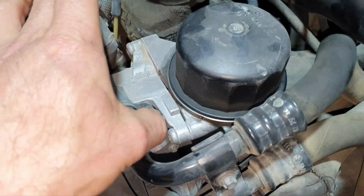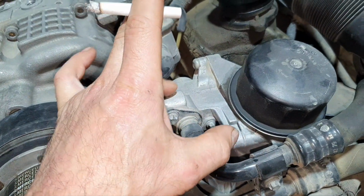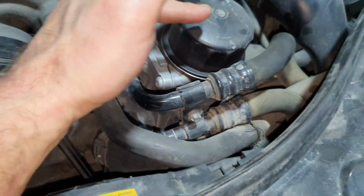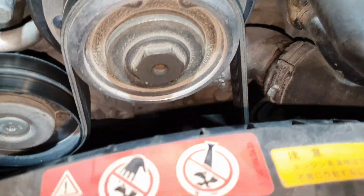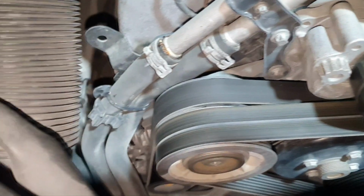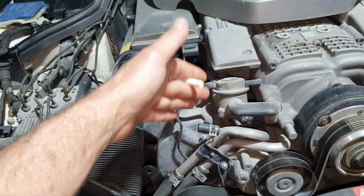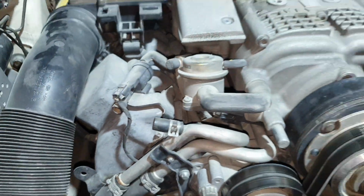This is the engine oil thermostat located here. The seals between the housing and the oil filter housing, the oil filter housing seal down there, oil filter obviously, engine oil obviously. The water pump looks like it's never been replaced, at least I don't see it nice and shiny, let's say, like the alternator. Fine. The cylinder head cover seals: the cylinder head cover needs to be resealed again and painted, because it comes apart, being magnesium, classic, all the time.